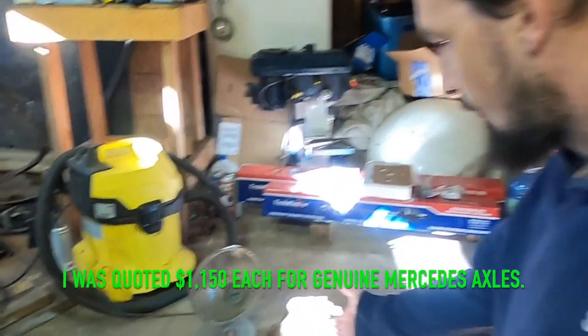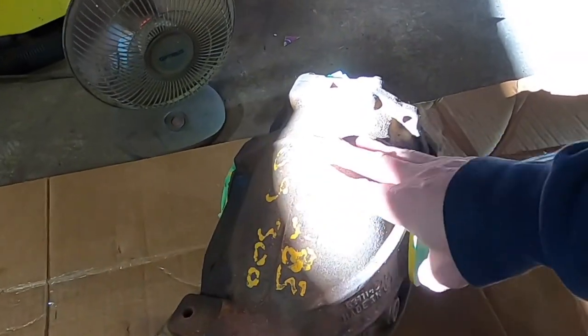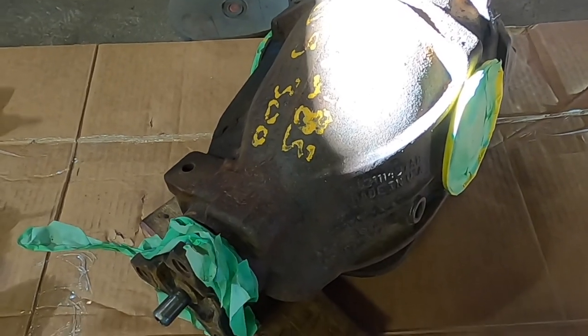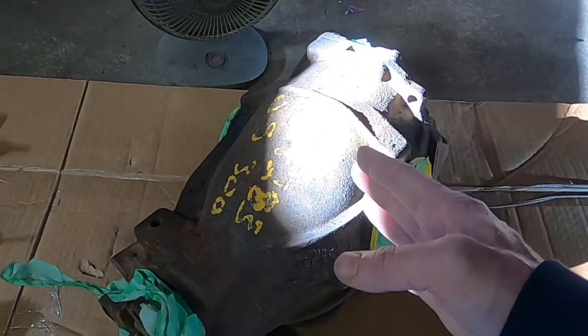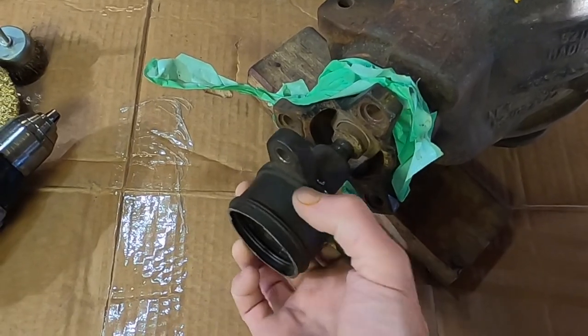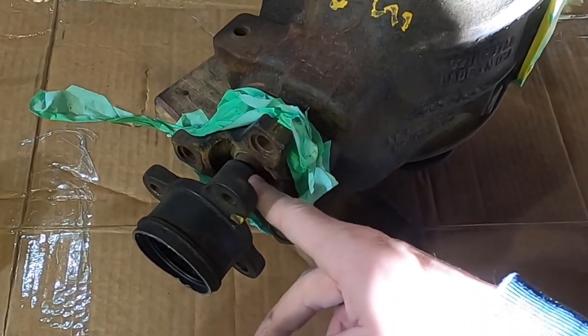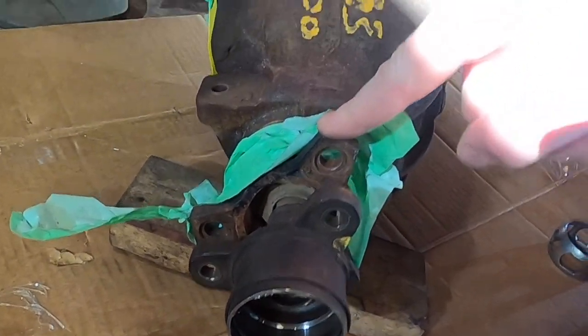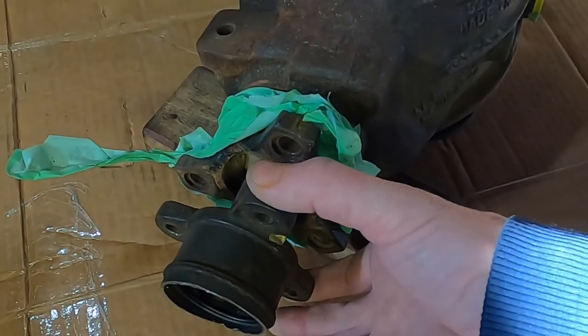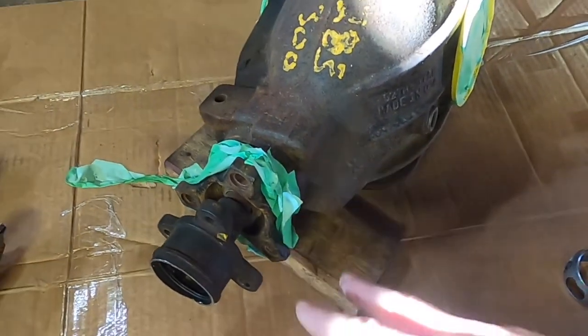What I discovered through research is that the 2008 Chrysler 300 differential mounts up the same. There's quite a year range where they're the same because Chrysler shared technology with Mercedes. Basically this mount point and these two mount points back here are the same. The unit's about an inch longer and it has a different drive flange. This is a drive flange the same as on my car from the front of my drive shaft — you can see the center bushing is the same, but it's a bigger flange. So I went ahead and got a brand new rubber drive coupler to fit this flange, and now I have to make a duplicate flange to go on the end of my drive shaft and shorten up the drive shaft.